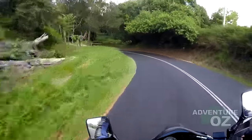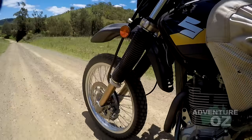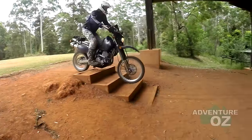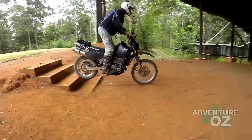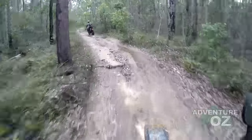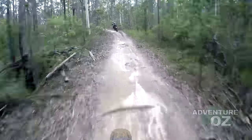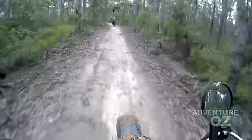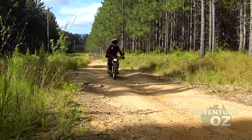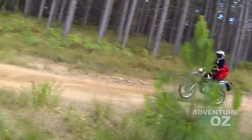It's so much better under brakes now — you can see there's very little diving when you hit the brakes. Our conclusions on the forks: this budget fork mod dramatically changes the fork's performance, but still falls short of a modern fork in terms of safety and comfort off-road. We regard new springs and appropriate fork oil as an absolute minimum, but would strongly recommend going further.